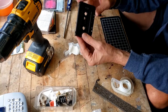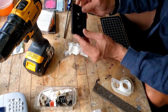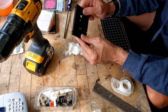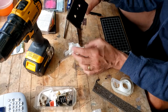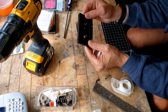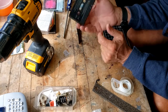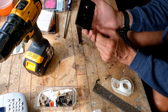I'm lucky in that I use Nakamichi tape decks, so I can manually set the chrome bias and EQ. You'd want to be careful about what type of tape you're transplanting into these shells. Since mine allows me to set bias and EQ manually, I can record on these even though they don't have the chrome holes for automatic detection. I've got about four Nakamichi decks and all of them are manual — they're a little better for working with these types of tape transplants where you're replacing normal bias tape with chrome.